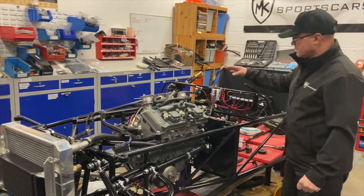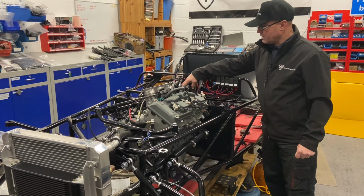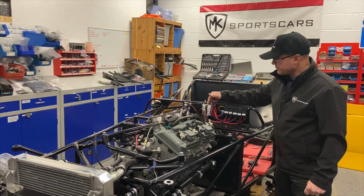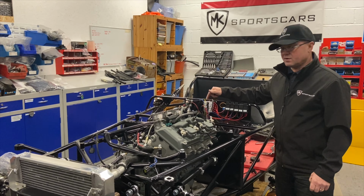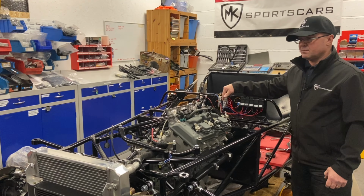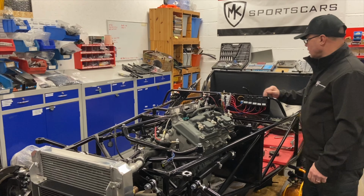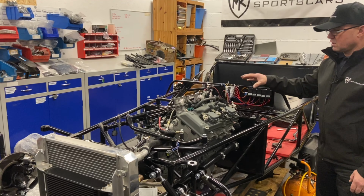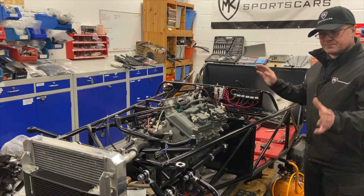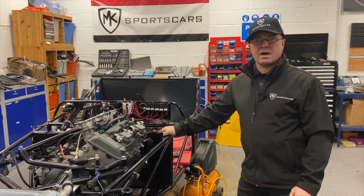We make the looms here, so it's got a custom fuse box, all the relays are in, all labelled up. All the engine's wired up now, all the looming, etc. We use an LED light fuse box, so if it blows a fuse, you can recognise which one's gone. It's not worth buying the standard cheaper ones. They're not much more money, so we go with that. It's much more reliable. Steering column, it's just been wiring really and running all the looms through. Looks a bit boring really, but that's where we're at with that particular car. So that's where we're up to this week.